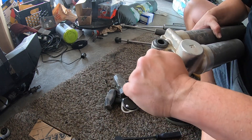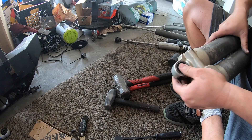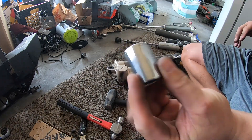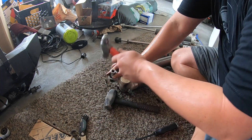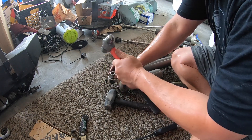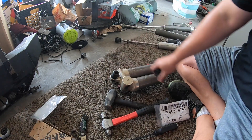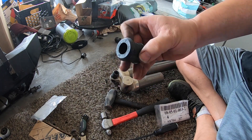That was terrible. Cut this ring out — let's go around it, cut the lip off. All right, there we go. And then all I did was take myself an 11/16th socket, put that up on that, and pop it out. Just take them over to my press, which I got when I did gears, and just press that in. Because if you want to fuss with that another way, good luck.